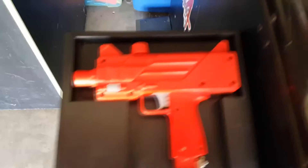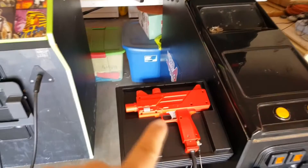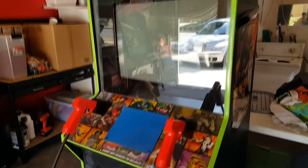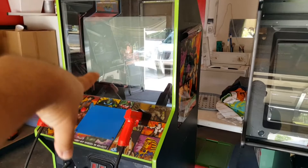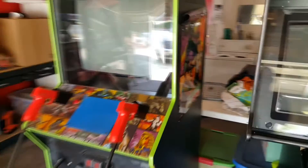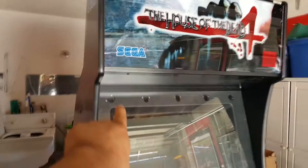Now the guns themselves — these guns are not like those guns. The main difference is these guns need sensors around the monitor. You got your typical HAP arcade guns. These guns can be used on a CRT monitor and only a CRT monitor. The reason being: you pull the trigger, there's a flash on screen, and based on where the sensor is and the flash, it registers the bullet. These guns are not like that — they actually use sensors around the monitor.